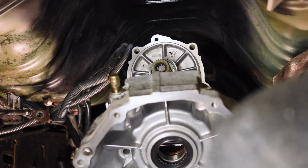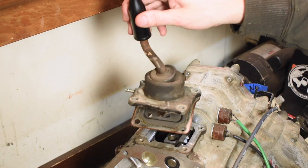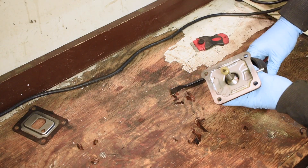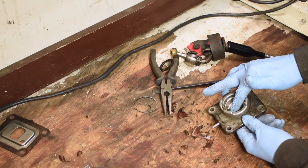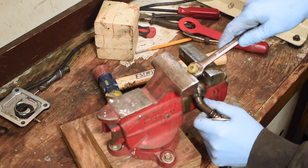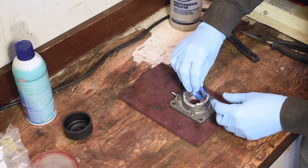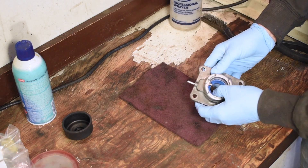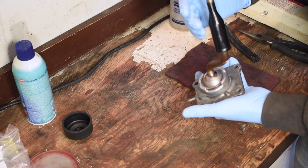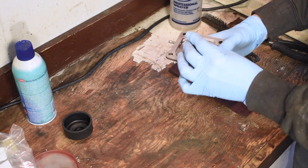With fresh FIPG, I reinstalled the extension housing. During the install I knocked the camera, so no footage beyond that point. With that done, I can now prep the new T-case to be installed. A known issue on these Toyota transfer cases is the shift seat tends to disintegrate into a sand-like consistency over time, and this one was no exception. After giving all the parts a good cleaning, I replaced gaskets, fasteners, the shift bushing, the shift seat, and even gave it a new boot. The shift seat I got from Marlin Crawler, which should hold up better over the years.